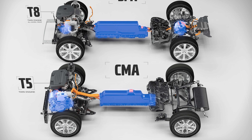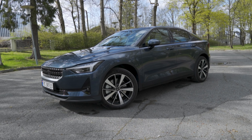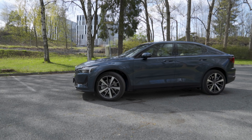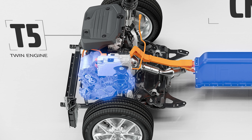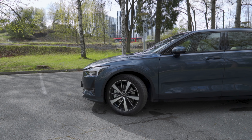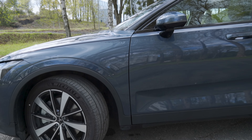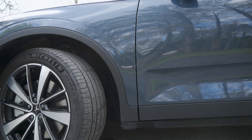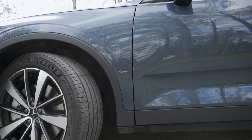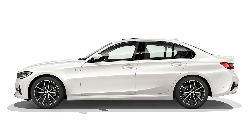When this platform was developed a few years ago, it was meant to underpin both petrol, diesel, hybrid, and EV versions. And if we look at all of the other versions, they are front-wheel drive based, with an engine up front and front-wheel drive and also the transmission up front. You can see that this is a front-wheel drive platform because the space from the front wheel arch into the front door is very, very short. That is a typical tell-tale sign of a front-wheel drive platform.